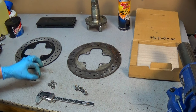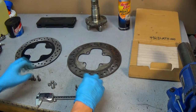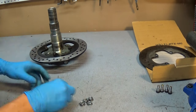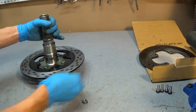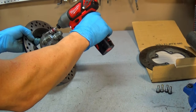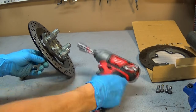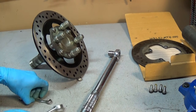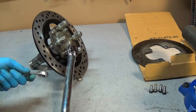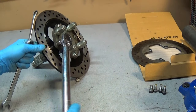I am going to make this part work though. I have bolts with the same diameter and thread pitch, as well as matching head size in height and diameter. The shank is about 3mm longer than the original bolts to compensate for the extra thickness in the new disc. The torque for the brake disc hardware is 25 foot-pounds. I'm going to double up my wrench to give me enough leverage to hold the bolt for the torque ratchet. Because this is a rotating assembly, I will use a crisscross torque pattern.